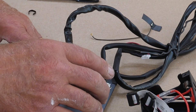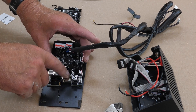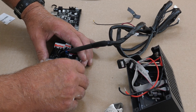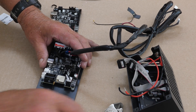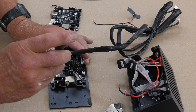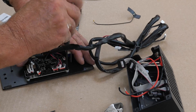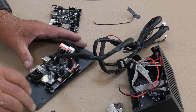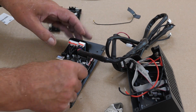Next we can get this board mounted back on the base. Make sure you don't get things backwards — remember this little gold connector has to plug back on there next to the Wi-Fi. Underneath each one of these four corners you'll need a spacer, then put your screw back in. The best way to do this is to just start each one a couple of threads, slide your spacer in, drop your screw in, and so on. Now we're back to that little gold connector — place it over the top of the pickup and push down, and it plugs right back in.